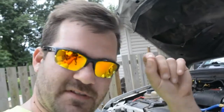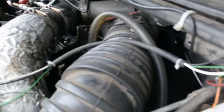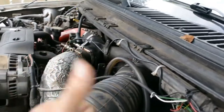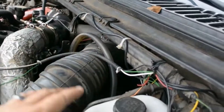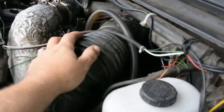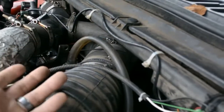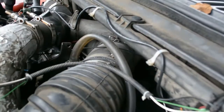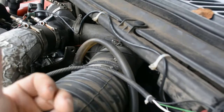The CCV mod — what is that? That is your crankcase vent — that is what CCV stands for. Your crankcase sits right underneath your intake. Your stock system is actually going to plug into the bottom of your intake on the turbo side — it's all connected but it's on the other piece. What that does is you have oil and stuff, you'll get blow-by coming out of your crankcase, and now it ends up inside your intake through your turbo and through your intercooler pipes. So I did away with that.